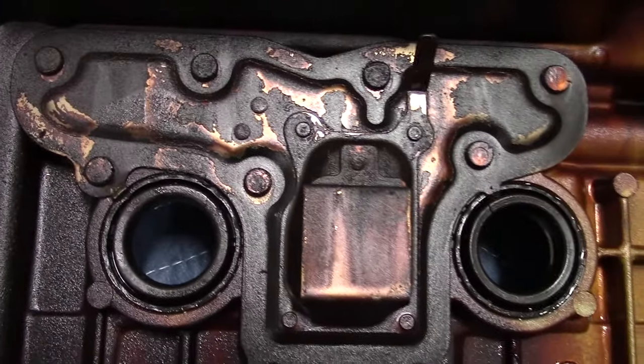You have these half moon caps that you want to remove from your engine — I'll point one out right there. You also have a cap in the back of your engine compartment. Here I take channel locks wrapped in tape to avoid damage to the half moon caps, pull it right out, and it just pops on out. Pop another one right on out.